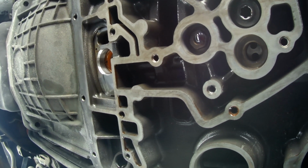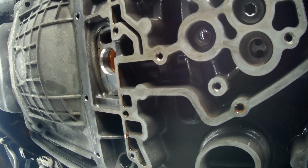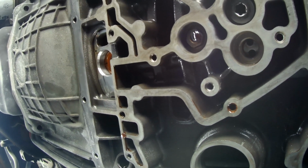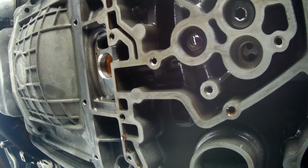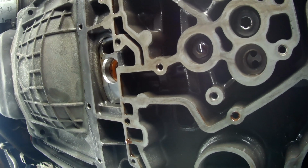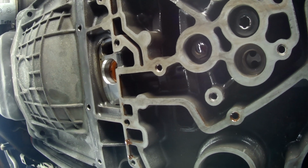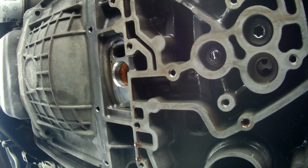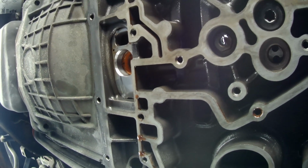And basically what that means is the pump inside of here will be under high pressure, all hydraulic fluid, and then all of a sudden it gets a compressible medium like air, a big air bubble in there, and then another shot of fluid at 600 or 300 or whatever the PSI is on that. You could shatter the pump and create some real problems. So you want to make sure to get those gaskets out. You don't want cracked filters, just to protect against cavitation, because that can wreak havoc on a transmission.